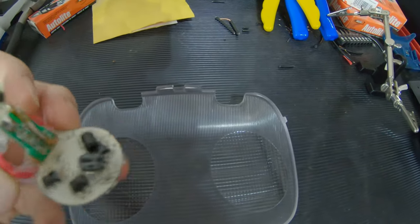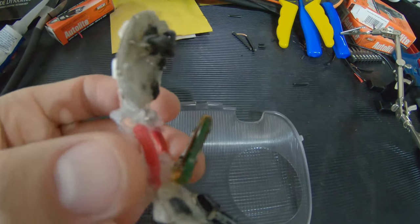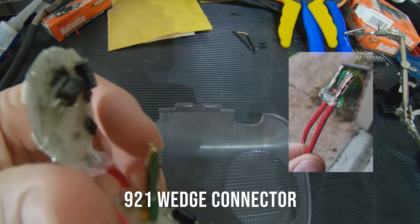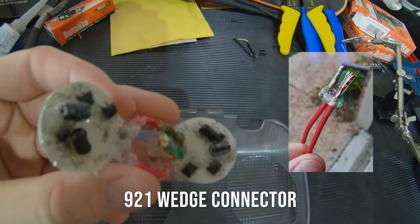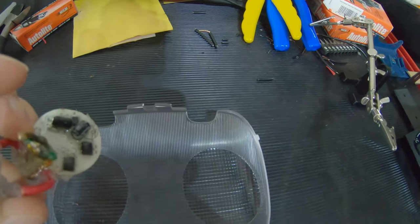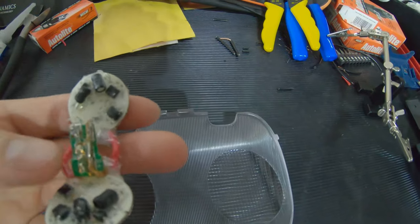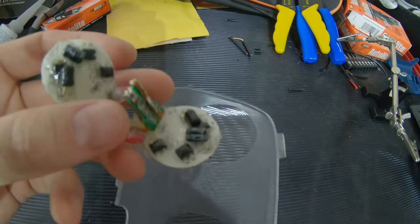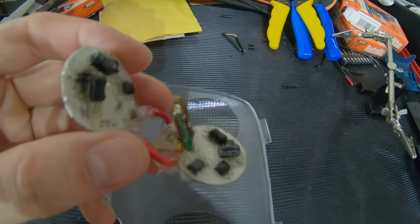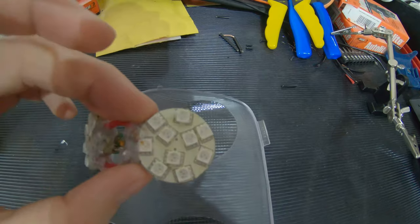As you can see here, I have this little circuit board piece, which is the shape of what the LED socket is. And then I wrap some wire around it so that you'll have the positive and negative. So when you insert this in here, it actually will close both connections to these two LED discs with the standard LED socket or halogen socket in the lighting housing.